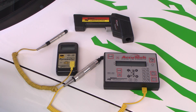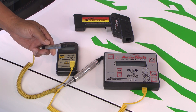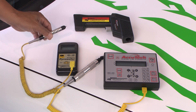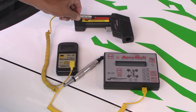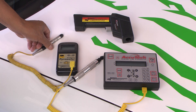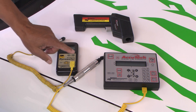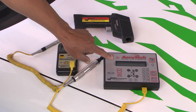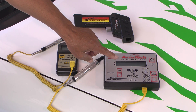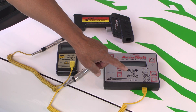How do you tell when you have the correct pressure and alignment? By using a probe type tire pyrometer. This tool determines the temperature of the surface of a tire by a metal probe that's inserted in the tread surface. We do not recommend using an infrared pyrometer because the readings can be inconsistent. These two pyrometers are from Longacre. The difference is this is a single reading pyrometer — it reads only one temperature — whereas this one over here actually reads all three temperatures of each tire and records those temperatures so you can refer back to them later. This one will store 10 sets of temperatures and it also has a built-in stopwatch function.